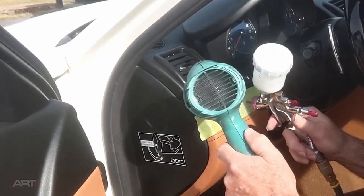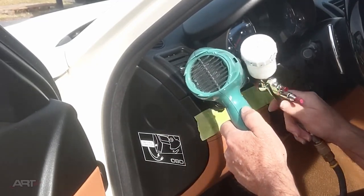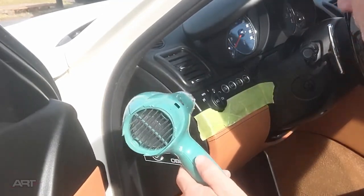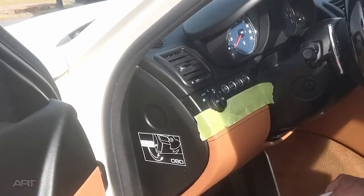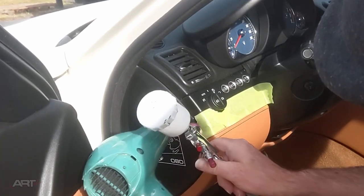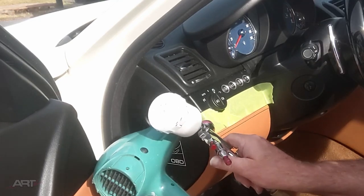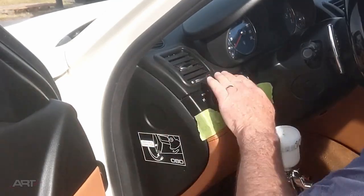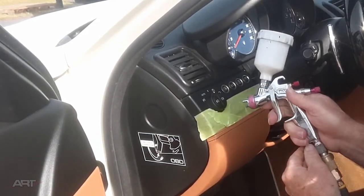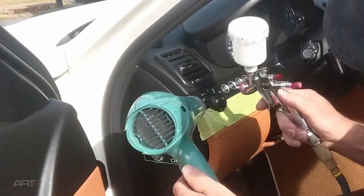The water-based plastic primer I'm using by default is a high gloss, so keep that in mind. If we're doing every button in the car it may not make too much difference what the gloss is, but you can always match the gloss to whatever the surrounds are. If you want to leave it shiny, fine — but you can always add some flattener to the mix and dial that in. You can make it satin or matte, whatever the need arises. You have control of that.